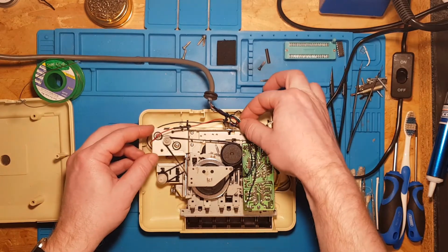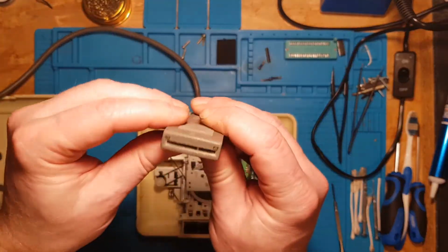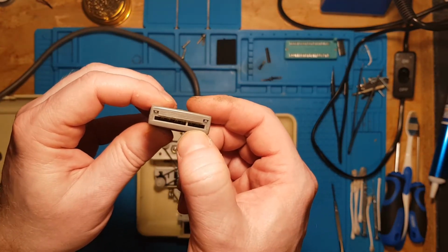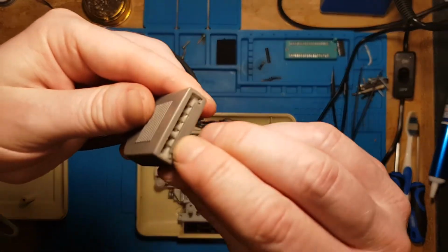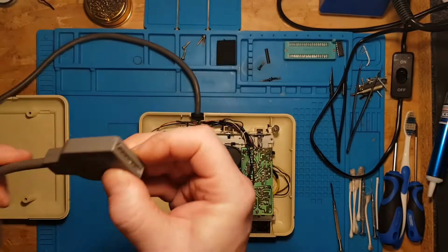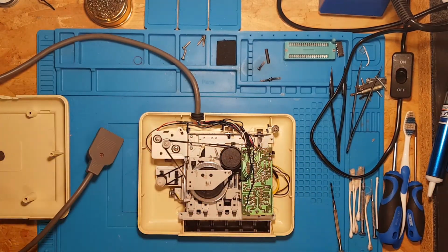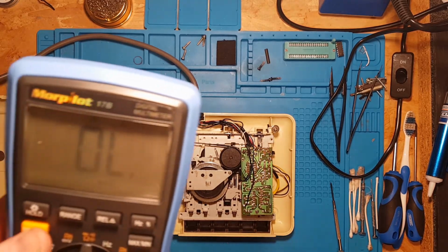So, okay, a good way to test. You can use a multimeter, and the positive and ground are those two pins there, if you can see them. So if I check them now, make sure they're not shorted anymore, which they shouldn't be, obviously, because the wire was broken. Then at least if I plug it up to the Commodore, it hopefully won't blow the fuse.